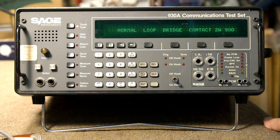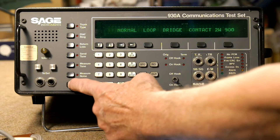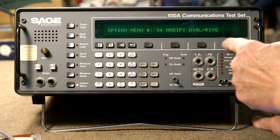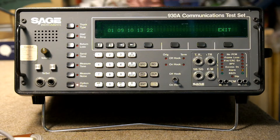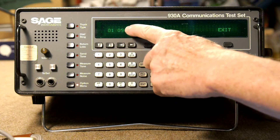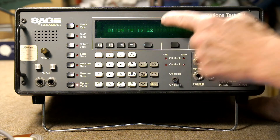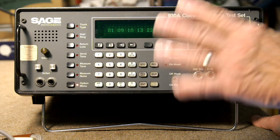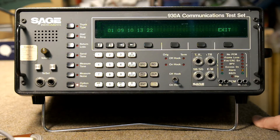You can ask the seller, if you don't have access to the machine yourself before you buy it, to look and see what options are installed. Tell the seller to just press the Option Menu button, then enter 94, and then press the button here. This tells us that we have Option 1, Option 9, Option 10, Option 13, and Option 22 installed. Option 1 is the digit receiver that we need to test our dial, and 13 is the ring generator, which will help us check out the ringers in these telephones.